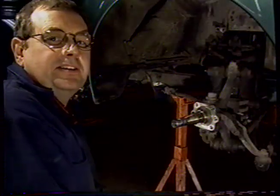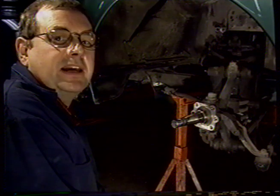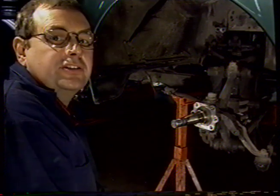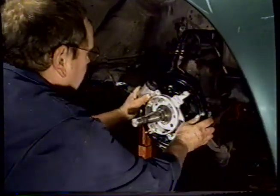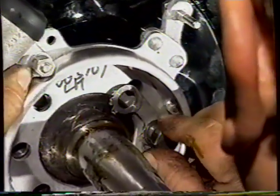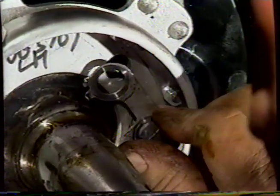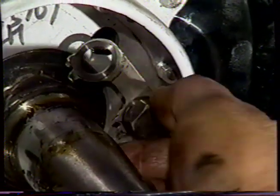You've seen us, we've completed the left rear wheel. We went on and we did the right rear wheel. We're now going to do the fronts. I'm going to fit the backing plate to the stub axle and the hoses to the bracket on the shock absorbers. Going to put the lock tab and the bolt. To wiggle it around a little bit. Get the bolt started.